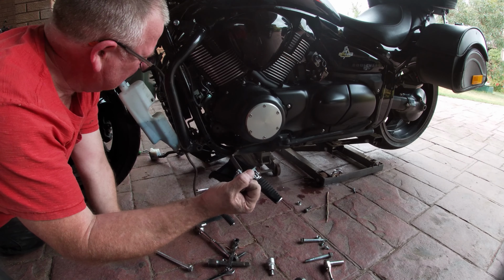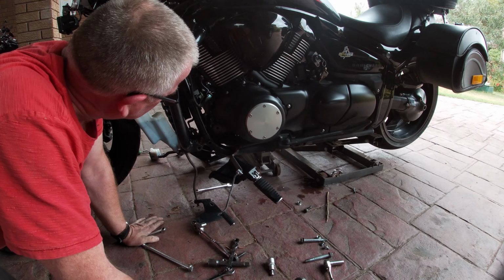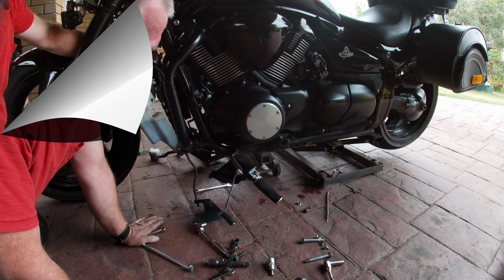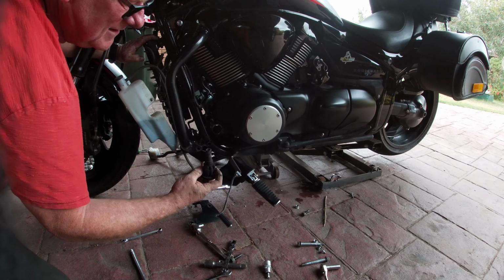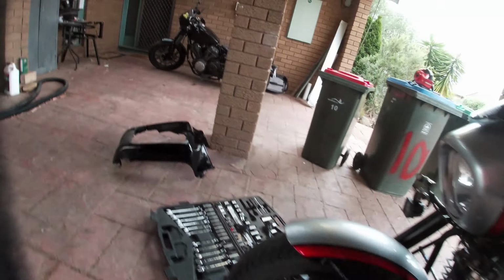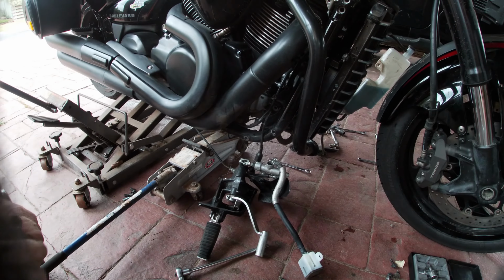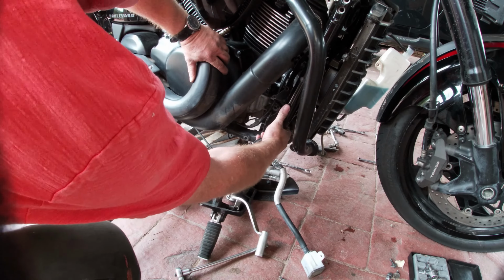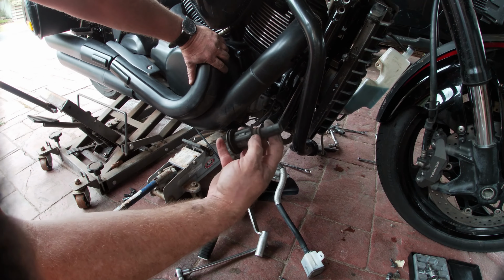So there's a bar in the middle between the two mounts, so as you can't push them too far in. I need to get that off. It's like a bar with a collar in the middle, just slide it to one side and the bar will come off. Hopefully. Actually, what I was telling you was wrong. This is your engine mount here, this will just peel out. There's one out. We'll go to the other side. And now see, this one won't peel out because of this bracket. That bracket doesn't come off, and that's why we'll have to take this bar off here. So 2 Allen keys under here, and then we'll be able to get the other mount out.